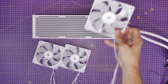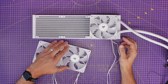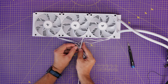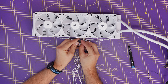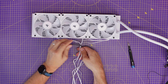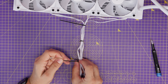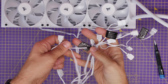These additional fans have the same sort of logic as the case fans that are pre-installed — they have daisy chain cables so you can easily set them up and wire them. I'm going to put them onto the radiator this way because we're installing it on the top of the case, setting them so they're pulling air through the radiator and exhausting out of the top. We need to make sure cable tidying is done nicely, as there are a lot of cables, and we'll connect them up to the CPU header on the motherboard.